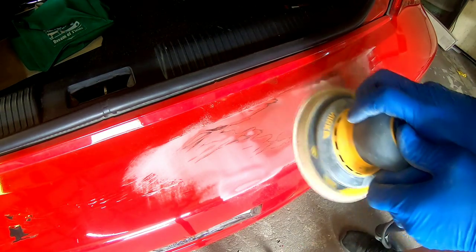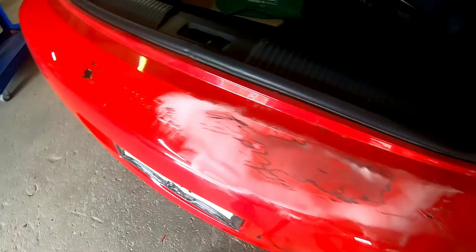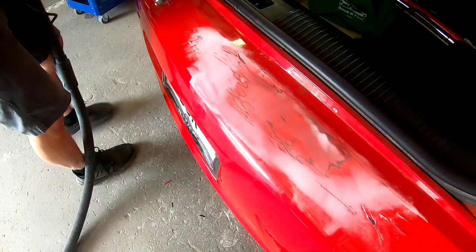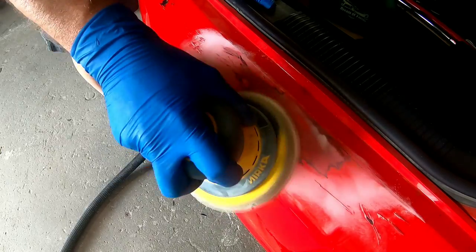The reason we start less aggressive is because you have to remove those aggressive scratches. If I use 180, I have to then remove those 180 grit scratches in order to get it down to 320 and ready for primer.